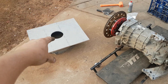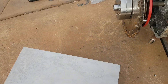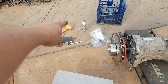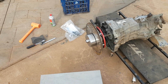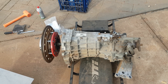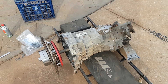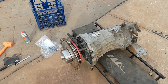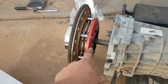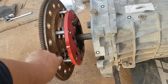The last clip you would have seen is this getting machined — that was a few days ago. This hole is exactly the same size as that, so it actually fits really snug in there. I'll just tap it in with a rubber hammer. This is the TR6060 6-speed out of a VE/VF Commodore — the one we picked up when we went and got the VN wagon from Melbourne. I got this from my mate Lee and it came with a clutch and a flywheel — some Direct Clutch Masters twin-plate, twin-disc setup. A light flywheel which I'll lighten even more eventually, because it's a really heavy setup at the moment.